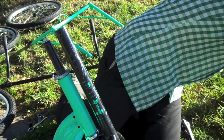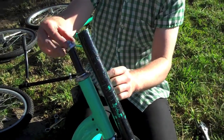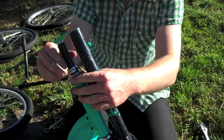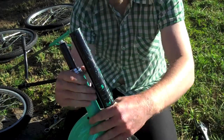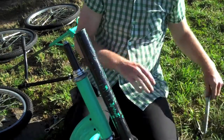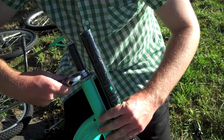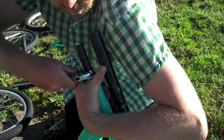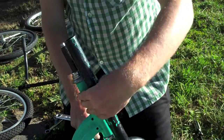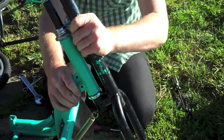Next locate the locking nut for the headset and the washer. Get the washer on first, then the lock nut, and install it. If the cup does not have a location for a wrench you can grip it with your hand and hold it in place while you tighten the headset. To make sure that the headset is properly adjusted, it should spin freely without play or jiggle and also not bind on the bearings. This will ensure long bearing life.